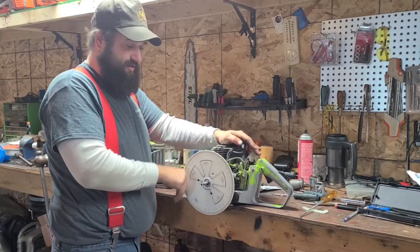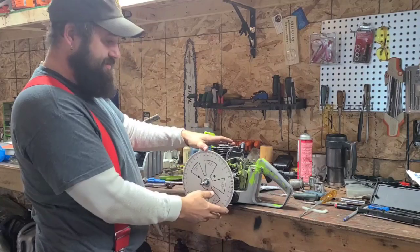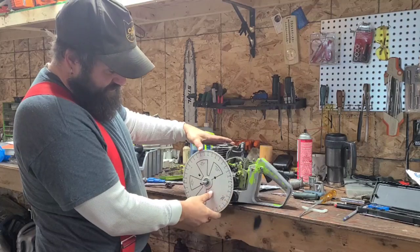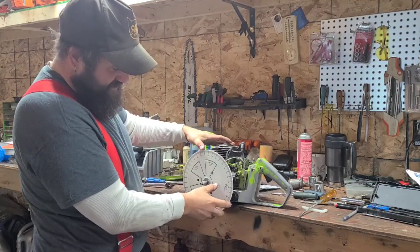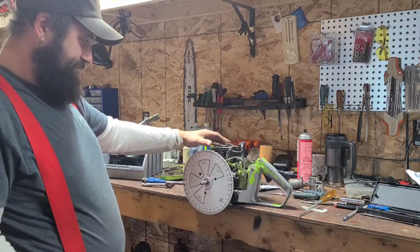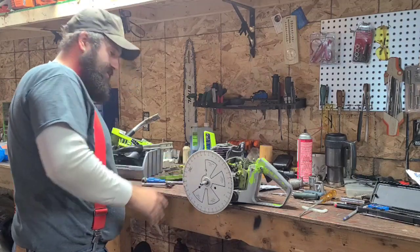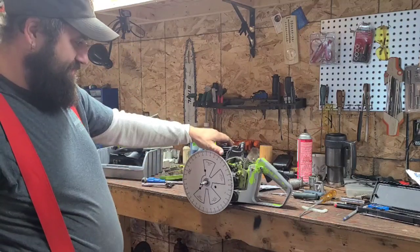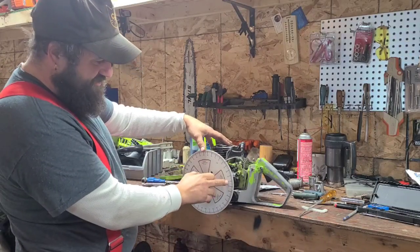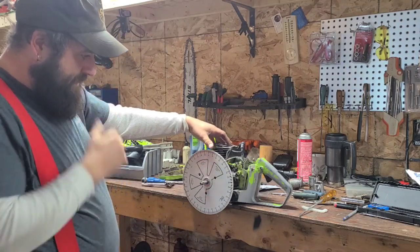Cylinder is going up, our piston's going up and down. It spins in the direction the chain goes. Top dead center. Exhaust opens. Transfers open. Going down, down, down. Now you can time when the exhaust closes. Okay, we're going to do that with the cutaway because it'll be easier for you to see. Duration is timed from if the exhaust opens at 104, right?